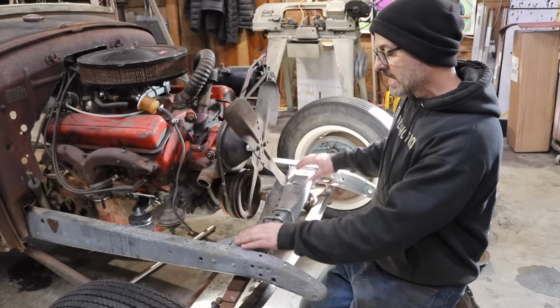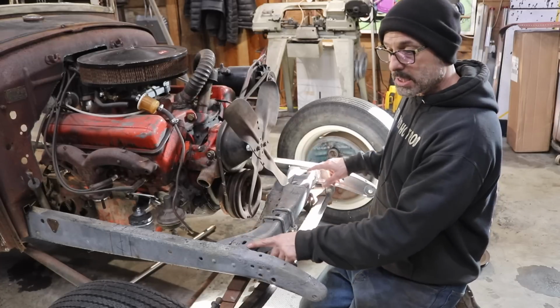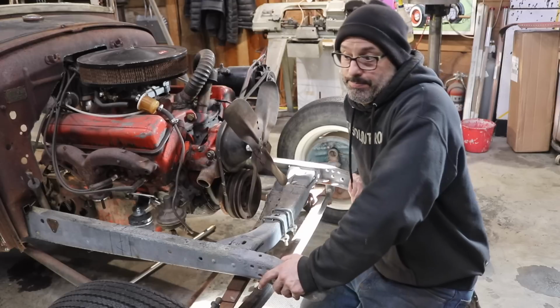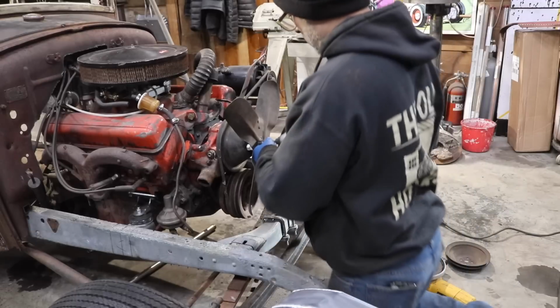member, get everything set where it needs to be, make sure my measurements are good, and I'm going to get these 2 little pockets cut out, and get this radiator sitting 1 inch lower, and we'll get some holes drilled, and get the thing bolted up and see how it looks. I'm going to remove this fan.